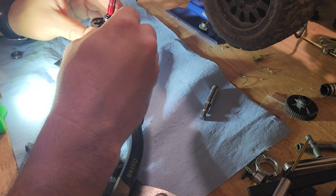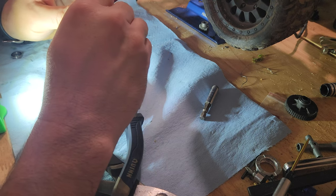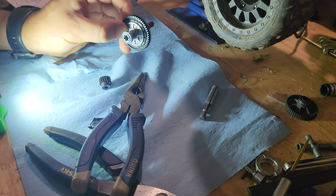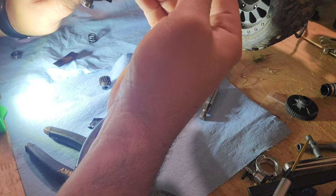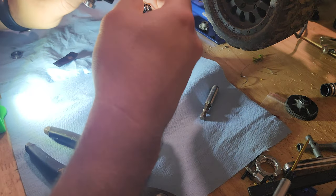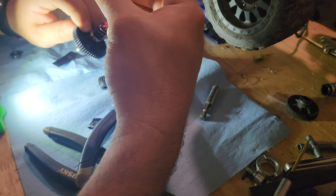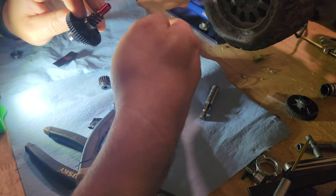I did the pin off camera — this is my second time doing it. Let gravity work with you when you're doing it because everything here moves unless you put the nut on. The next step: put the spring on — that's your spring — then put the locking nut right on top. This is a really nice locking nut that allows the clutch to be nice and tight.